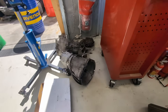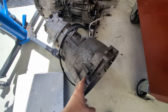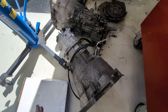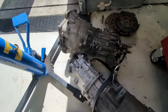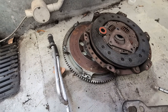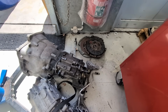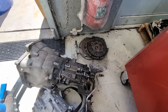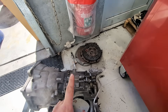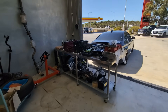There are two gearboxes here. This one at the front is my new gearbox — a 420G from an E36 M3, so it's a six-speed which will better match the rev range once the engine is done. I've also changed the final drive; my LSD is being rebuilt with a 4.1 final drive. That's the original gearbox, and over here is a lightweight flywheel, which is another RHD product and is a great place to start for modifying your car.